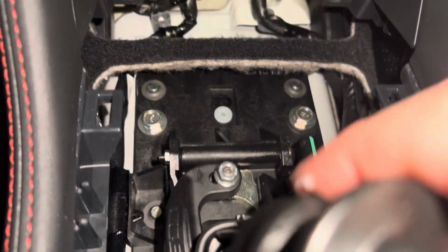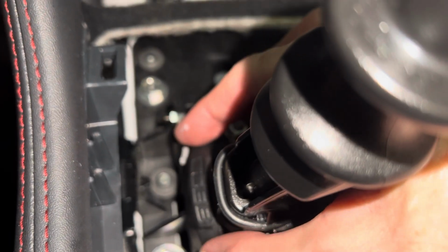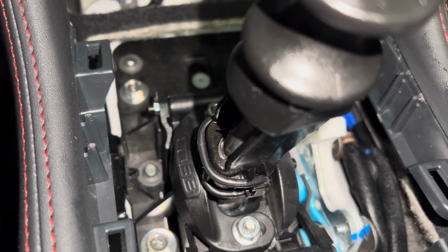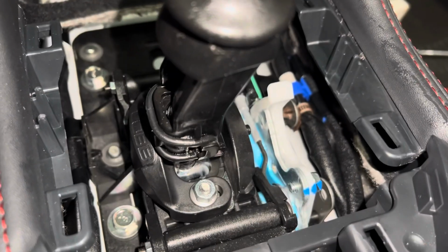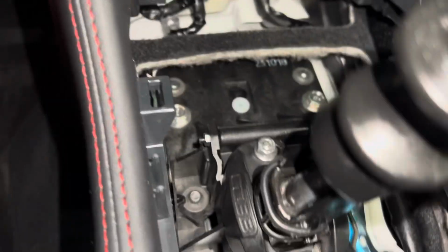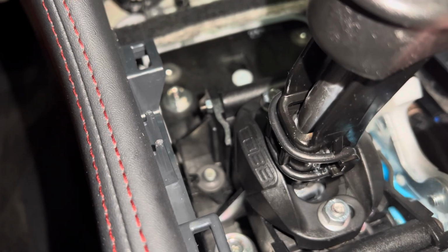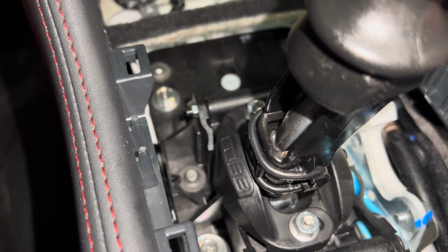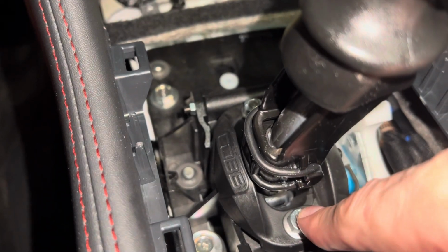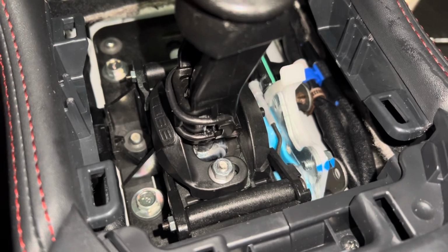We're gonna go ahead and adjust this side to side in first and second gear. I'm gonna try to match what the slop is like in fifth and sixth. I think the COBB instructions also say the width of a zip tie, so you could place a zip tie in here in first and then back it up, but I'm just gonna mess with it a little bit, see where it's happy, and then lightly tighten these guys down, run it through a few times, and then send them home with the 5 foot-pounds or 60 inch-pounds.